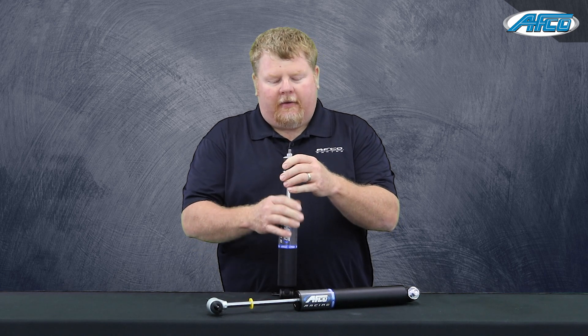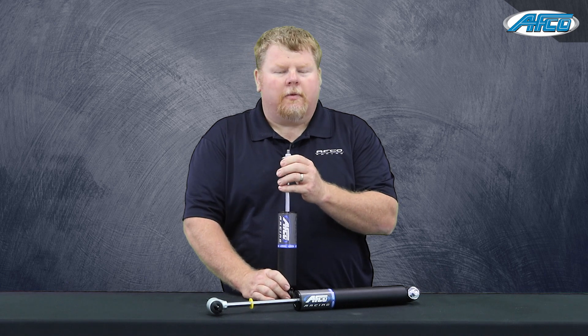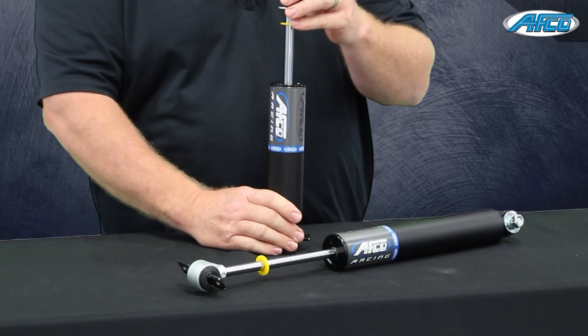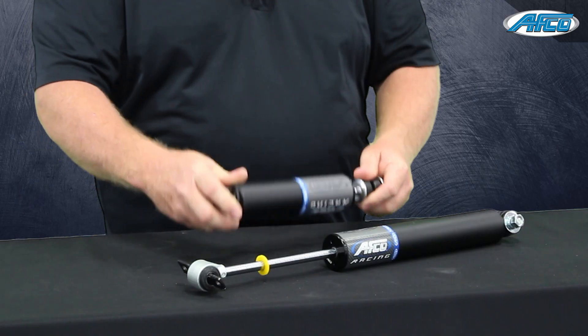The other thing with these is that because we started basically with a clean slate, we've minimized these front shocks to match the rules as best as possible. So we've shortened the shock in the fronts to get the car down and get the front end geometry what we want it to be.